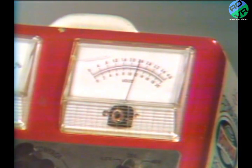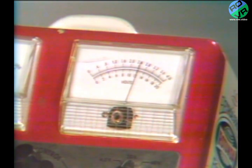We note, however, that our alternator output remains at 12.5 volts under the load. In other words, the bypassing of the regulator and feeding full battery voltage to the rotor field windings did nothing to improve alternator output. At this point, we strongly suspect a faulty alternator.